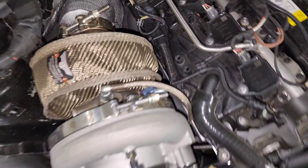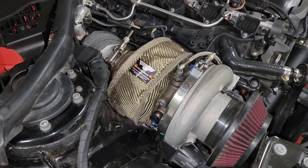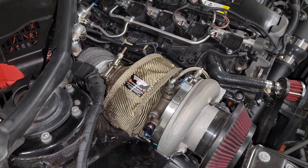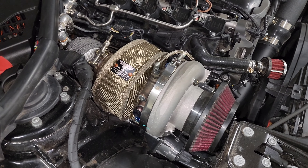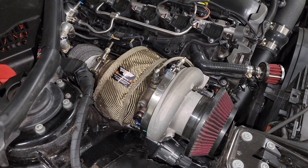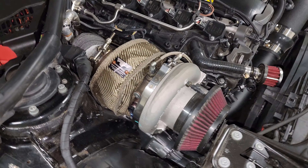I'm seeing a big issue with how this turbo blanket fits with the kit. I'm not able to access any of the bolts that were causing me issues, and especially when you first install this kit you're going to want to drive it, do a couple heat cycles, and then re-torque everything down. To get to the bolts I've got to basically pull the down pipe, remove the wastegate, and pull the turbo blanket — doing all of this just to access those bolts and tighten them down. I wanted something with a little more clearance, something more sleek and cleaner.